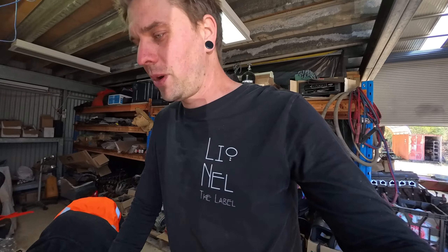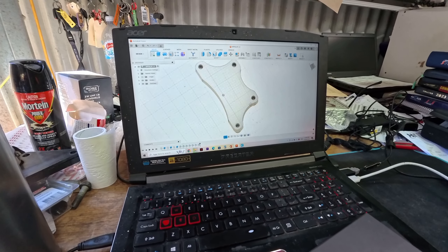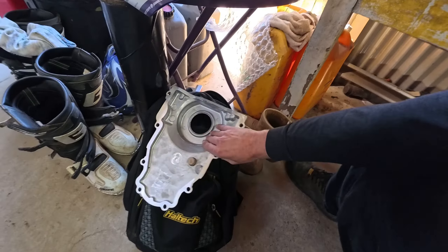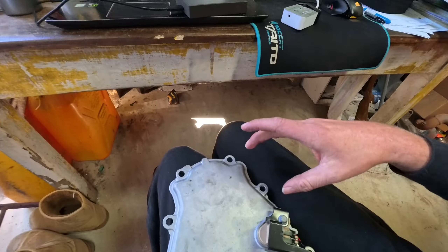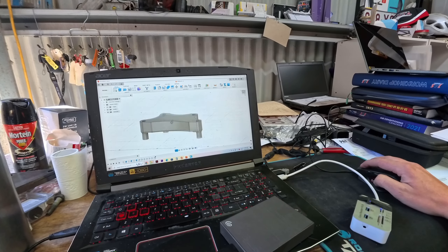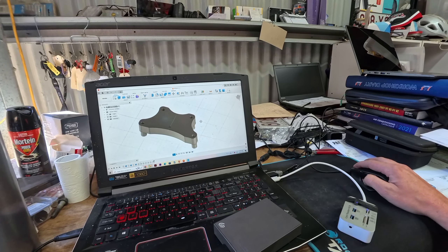It's got me stressing because the 3D design takes so long and the deadline is really fast approaching. There's no way to cut corners and rush it. I feel like I'm getting pretty good at it but it's just a lengthy process and I've still got to get both the pump bracket and the idler bracket CNC'd. My prototyping approach is to get something in the printer as early as you can with minimal infill - light and weak, just to test critical dimensions - and then move on once those are confirmed right.